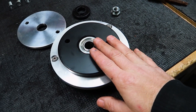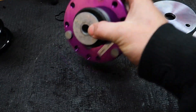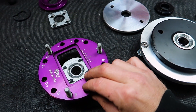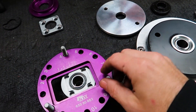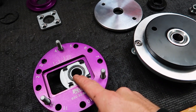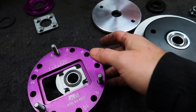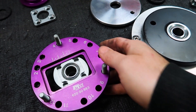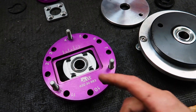This route will get us about another inch of drop. We need to check with the customer whether he wants to keep the camber adjustment or go for the lower drop. We can build a certain amount of camber into the plate as a fixed unit. Since the vehicle was already centered when we started, he may not need the added camber. After talking with the customer, he wants us to add in a little bit of camber and remake the upper plate to get it down lower.